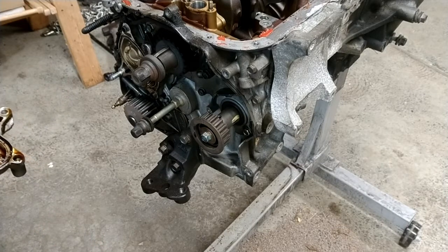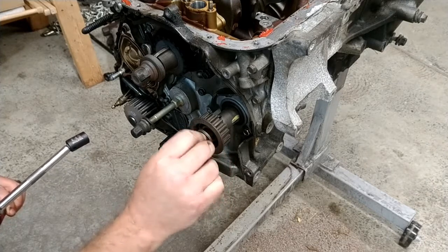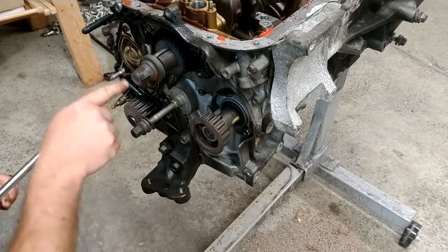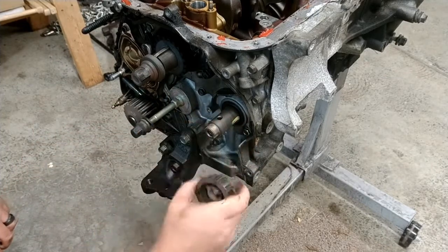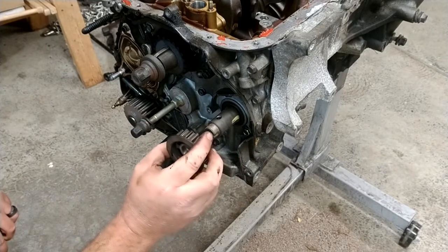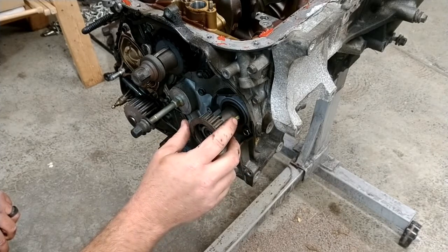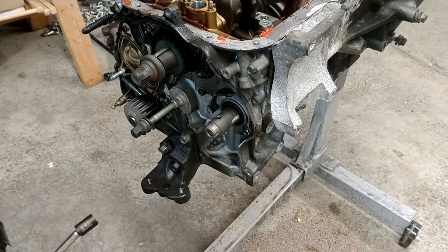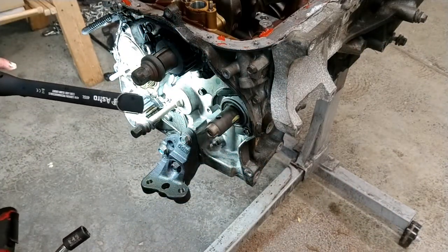I've never worked with this before so I'm going to try to be very careful and keep up with where I'm at. These have timing marks on them, so I'm going to have to look that up. Since they're weighted, when they spin they have to spin together in a certain configuration. This is keyed, so we'll have to make sure when it goes back together it's done the right way so we have a well-balanced engine. Imagine if you got those two guys out of whack — the engine will try to jump all over the place. And there is a bearing seal in there.